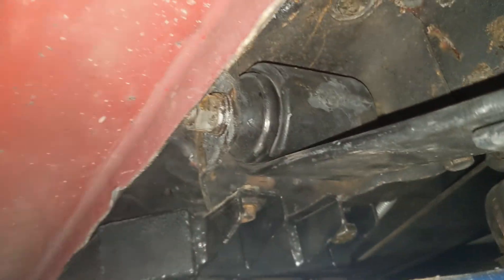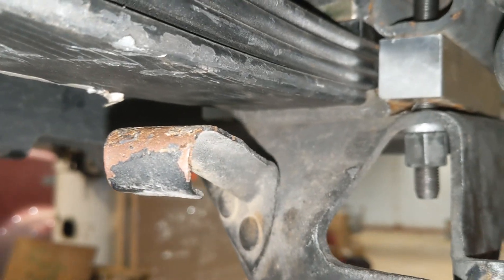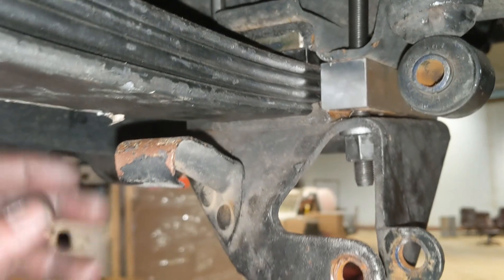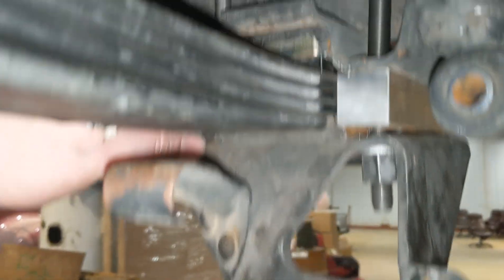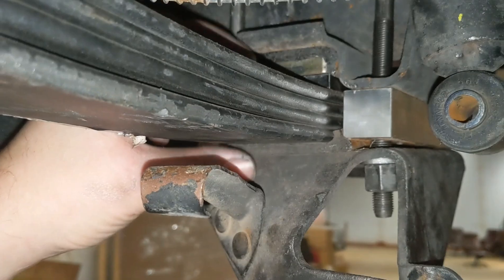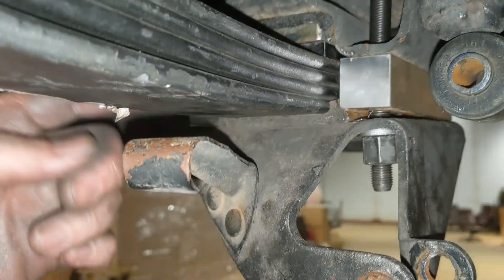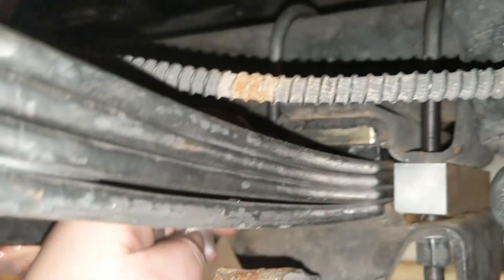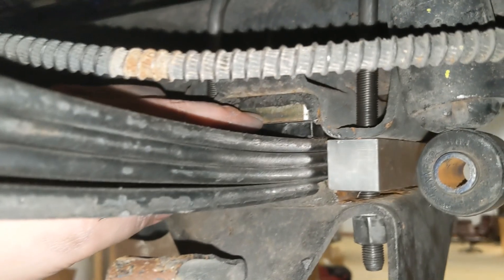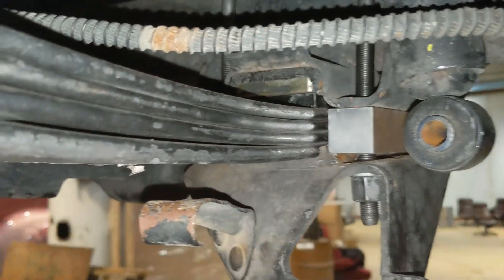Still got to tighten up the stuff in front but the lift is in the way right now. I did end up having to use the original plastic pieces that they said not to use unless the spring perches were still loose after getting everything tight — and they were still loose, so there was too much free space. Took it back apart, put the plastic ride spacers back in and now it's real tight. This piece came with the Detroit Speed kit.